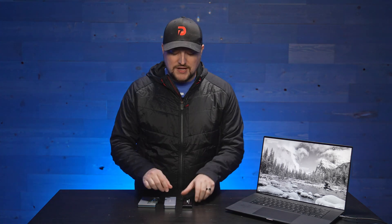These are super easy to make and if you've got the time and the tenacity to do it, anybody can do this. This is perfect if you're into photography or cinematography and you want to have a large volume set of drives with you, but you don't necessarily want to take up the space that a normal 7,200 RPM drive would take up. This two terabyte NVMe SSD transfers at about 600 to 800 megabytes per second via USB 3.1. The Thunderbolt 3 transfers a little bit under a gig a second, depending on what NVMe SSD you're running. A lot of different flavors, but these are so easy to make.